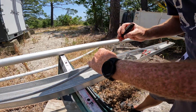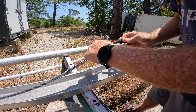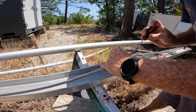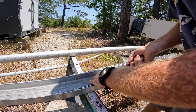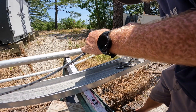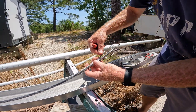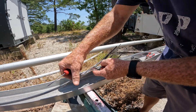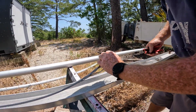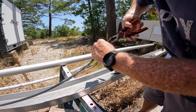I use this little pick and I unwind the outer layer of the cable — just like that. See, it just unscrews itself. I take the inner core and I note that the inner core has a little bit of a burr on it. So in the direction that it's wound I'm going to put a pair of pliers on it and just spin it, and that will clean that burr up a little bit.